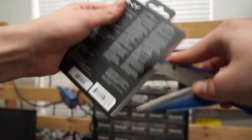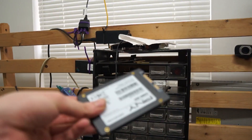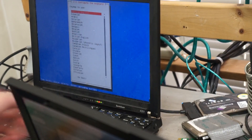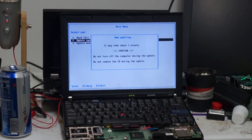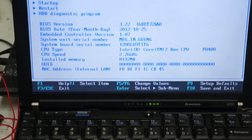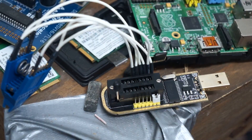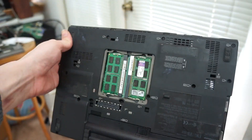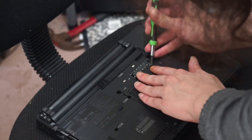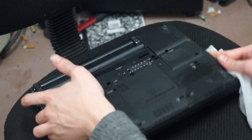I had a new PNY drive for this — I'm going to take that apart and install Debian on it. This was actually before I put in the hard drive caddy, but I wanted to make sure the battery was working. I got a bootable disc off the Lenovo site, installed that, and began flashing Libreboot. I have two flash options for this — for some reason it was a little bit hard with the CH341, but I got it installed, put some RAM in the back, got it cleaned up, then started finishing the installation and put all the screws in.